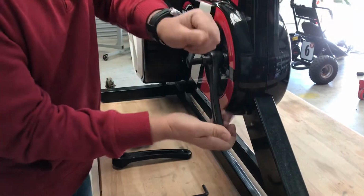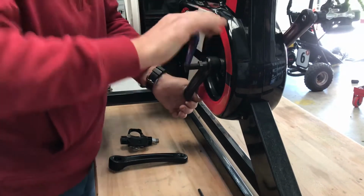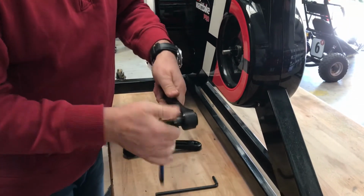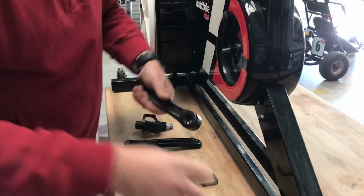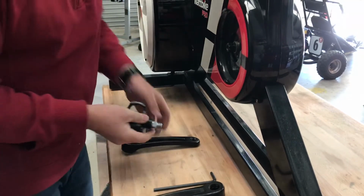and then you simply wind the crank removal handle in. It takes a bit of strength, but what it's actually doing is pushing the barrel that way, and very quickly the crank comes off. Loosen this off, remove the crank removal tool. Remember to remove the barrel.